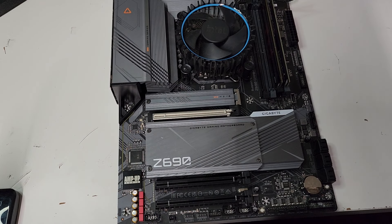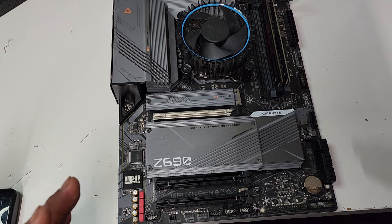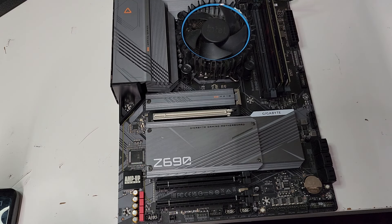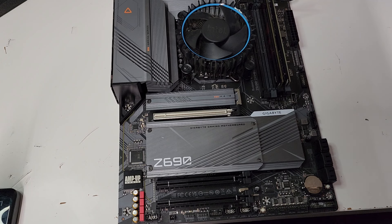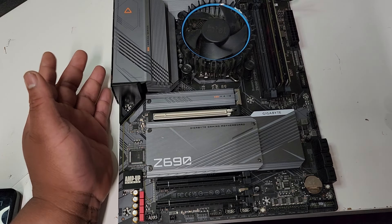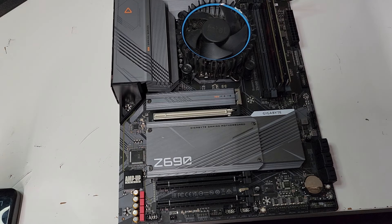Basically what I'm going to do is shower this entire motherboard with alcohol and brush it down. That's what I did to a motherboard before and it worked. I don't know if it was because I was brushing something off or the alcohol cleaned something off — I'm not sure. I'm just going to attempt this. The motherboard doesn't work, so at this point it's useless to me. I get a single VGA red light no matter what I do. I plug into the HDMI port — no display. I connect a graphics card — no display. The fan keeps running but nothing happens.